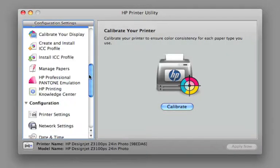Now, on the 3100, as we mentioned with other printers, one of the most important things is to be able to calibrate and get a profile of that printer. Now, you can go out to the web and get probably a generic profile for that printer or for some other manufacturers, but we recommend that you profile your exact situation, right? Your printer, your paper, along with whatever ink set you have currently in there. Now, you can do that multiple ways. With the smaller 13 by 19s, you can use the ColorMunki or even go with the i1 Pro and use those as calibration tools, printing out a chart and then reading it back in. Or, as we have with the 3100 here, a unique situation, it has the i1 Pro built in. So now I can tell the printer to calibrate itself and give me that profile back.